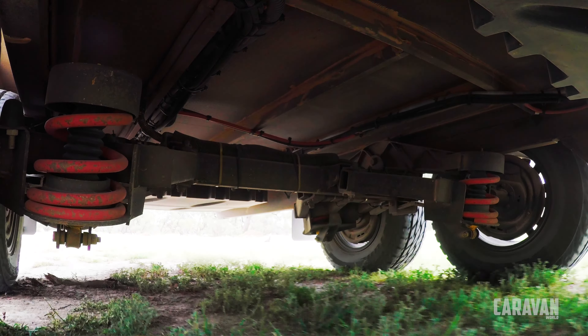This particular Bush Tracker uses a flexible solar panel arrangement which saves about 80 kilos from the roof — really important for your centre of gravity. They're also set on a core-flute-like material that helps keep the heat of the solar panels off the 75mm-thick ceiling. A C-Zone digital switching system incorporating an iPad app controls the whole van. One particularly interesting feature is turning on the Truma Aventa air conditioner remotely to cool the van for the last hour of your drive — feeding it power from the Anderson plug and solar means it won't impact your 600 amps of battery. When you pull up, the EnerDrive 3000-watt pure sine inverter powers the Thetford induction cookers, the combi microwave oven, and AC.